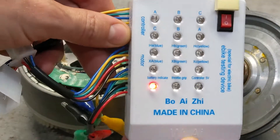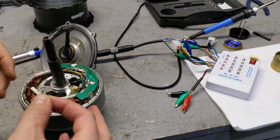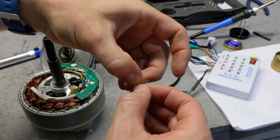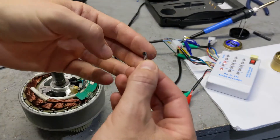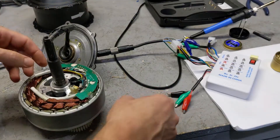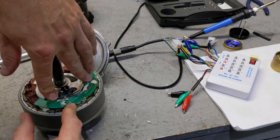We'll have to test the motor first with one of these testers. This is going to tell us which of the sensors has broken. So you have a hub motor that is malfunctioning. How do you test it out? The most common thing that happens to the motors is these hall sensors. You can see I have one over here. They are located on this board on the Himiway cruiser, but any hub motor has them.